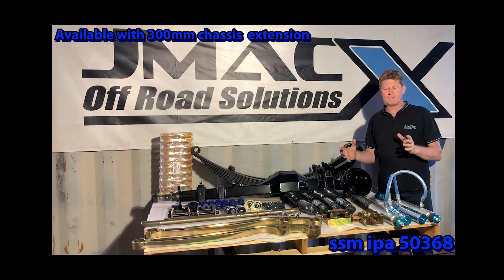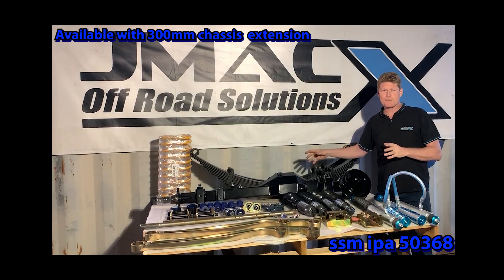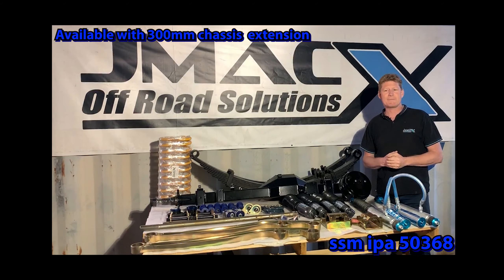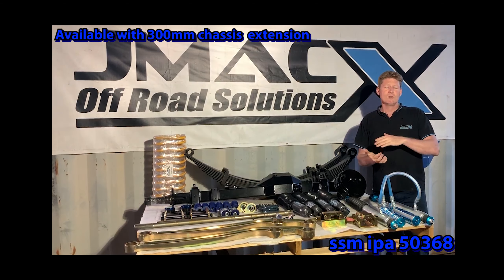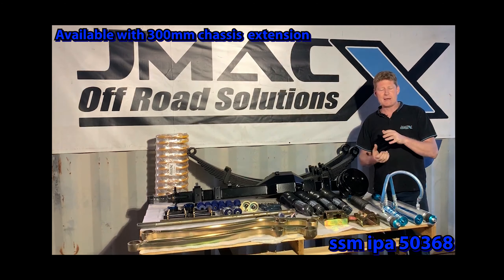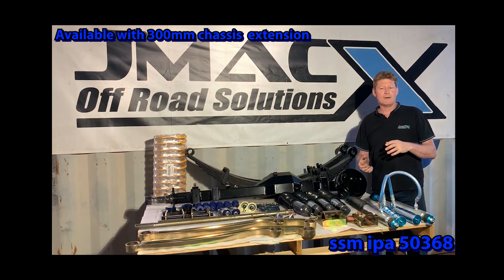In the space of leaf sprung vehicles, you've always got to remember that with a leaf sprung GVM you will have requirements for set weights. If you buy a GVM upgrade, you might have to have a constant weight or a partial weight depending on your spring choice. You are limited in that spring suspension space, but obviously the next step up from that is coil.